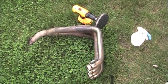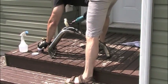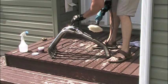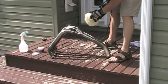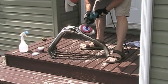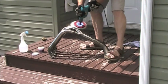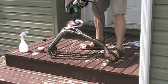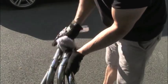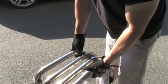The exhaust is a whole different matter — it was severely corroded down underneath the belly of the engine. I used Mother's metal polish, a water spray bottle, and a drill with a wool buffing wheel attached. The drill gets enough heat and speed to do a better job than trying to do this by hand, which would have taken weeks. You spin the wheel and rub it into the metal until the paste turns black — that's when you know it's really working. If it starts drying out, spray a little water on it. With a couple hours of work, this thing really turned out beautiful — just like chrome.